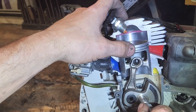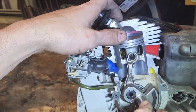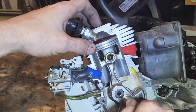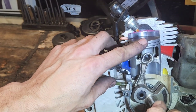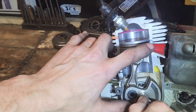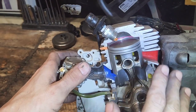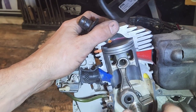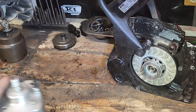That's again why you can't just raise your exhaust without any machining — you're going to lose torque. If you don't think that matters, take your top ring out and take a compression reading, or try to run your saw without your top ring. Your top ring in relation to your intake opening is very important. On your upstroke you're taking in your intake charge and compressing at the same time. If your ring is not above the exhaust roof when your intake starts to crack open, you're basically running a free-flowing system. This rule I would write in stone.